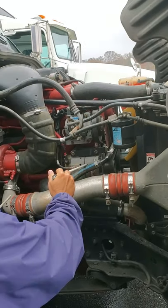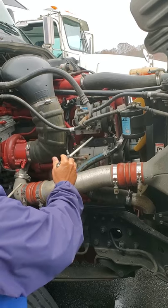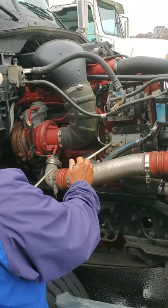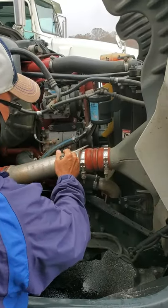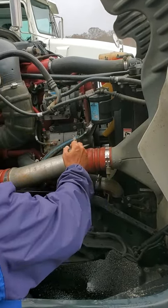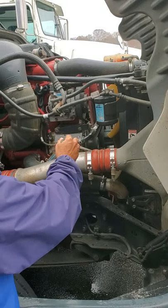I'm going to check my alternator. Make sure it's securely mounted. Wires are in tight, not loose. It is a belt-driven alternator. Make sure there's no more than three-quarter inch play in my belt. No cuts, no frays or damage in my belt.